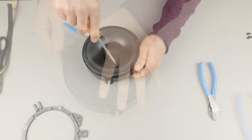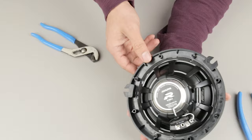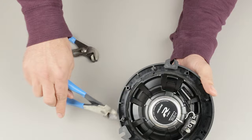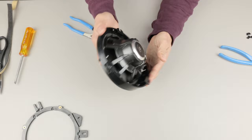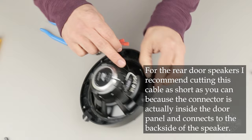Once you're satisfied they're tight, flip it over and you're going to notice that some of the screws are actually protruding quite a bit — so that's not going to work. The speakers didn't come with smaller screws so I just used those anyway. If that happens to you, all you have to do is grab some diagonal cutters and just cut the screws off. Next step is just to plug in the wire cable to it. You don't have to worry about which is which because one is big and one is small and these come keyed, so you just match the size.